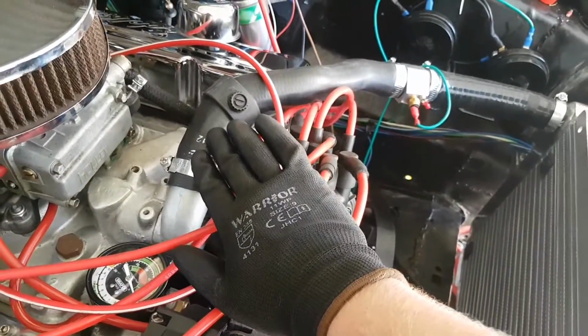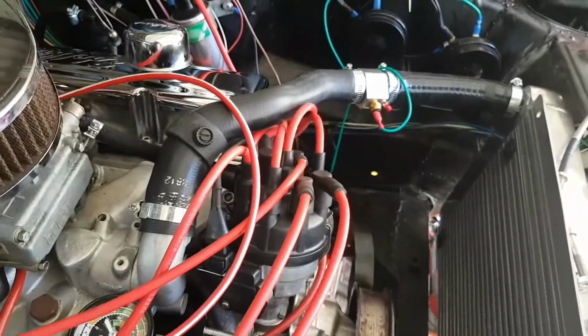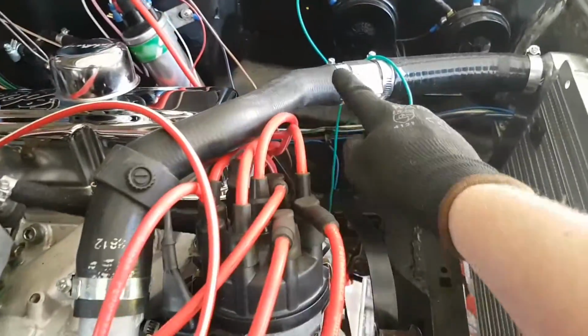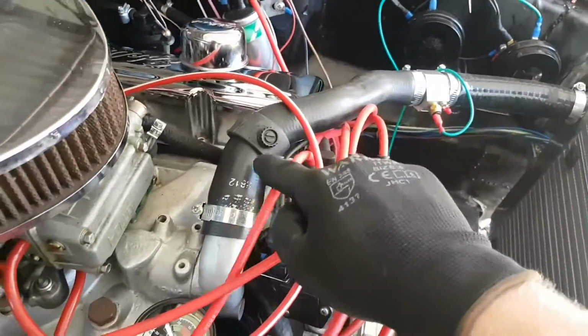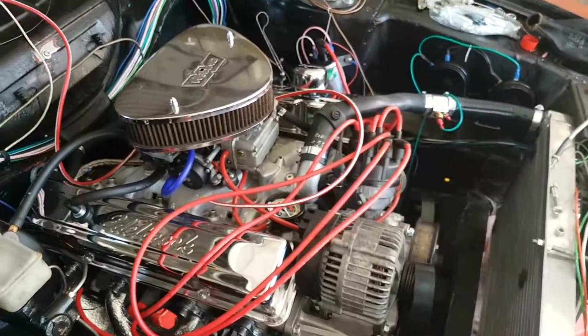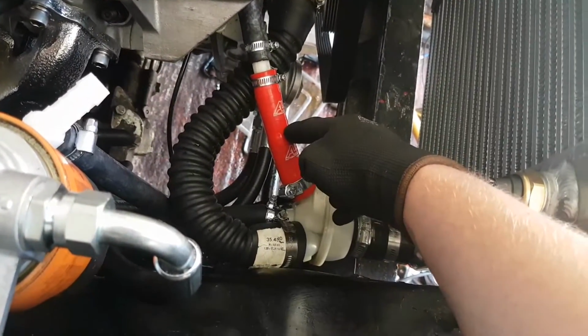This here is a really, really lucky find. This is the top coolant hose off a Renault Twingo. So it's 38mm here and 32mm there, and the bend's in the right place, and the bleed is at the top part of the system, which is perfect for this application. So if anyone else is looking for the parts, all these adapter parts can be found on Auto Silicon Hoses.